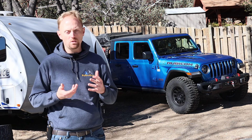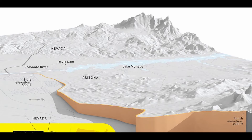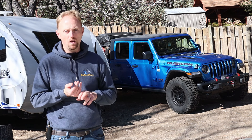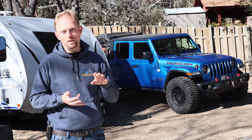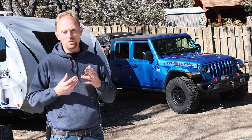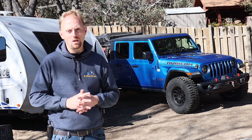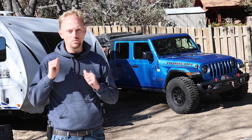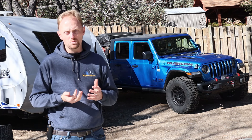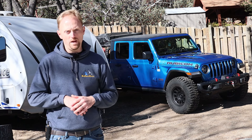Let's briefly talk about the SAE J2807 towing standards. They certify these trucks at a test site in Arizona near the California border — they go up and down steep grades for long distances at very hot temperatures, proving the truck can accelerate in a certain time, stop in a certain distance, and maintain speed up the hill without overheating. What Jeep is saying is that this gas Rubicon is rated to 7,000 pounds in those very difficult conditions, so it should be good for most people.